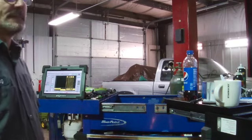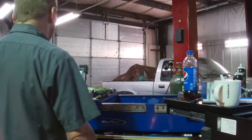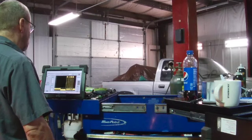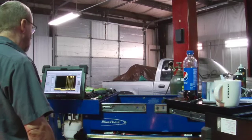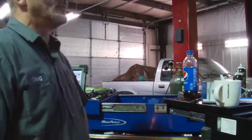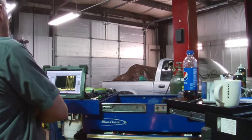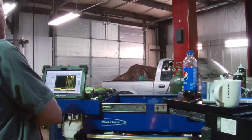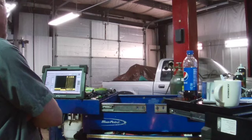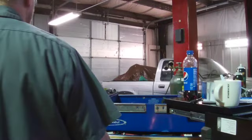There's a problem, folks. Definitely, there's a difference on that, and that is the one that's setting the code. We're pulling approximately 900 milliamps on that one. So we've got an electrical problem. That one is not turning on.